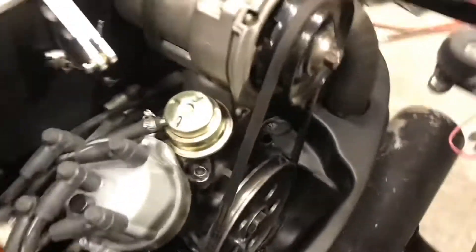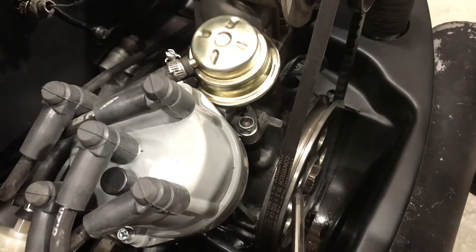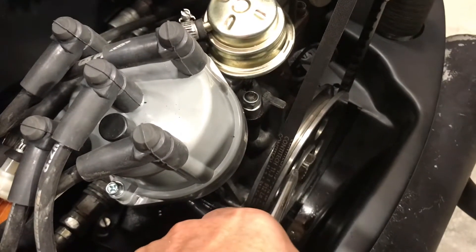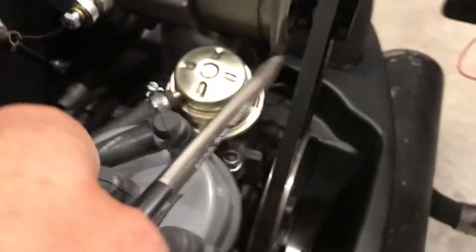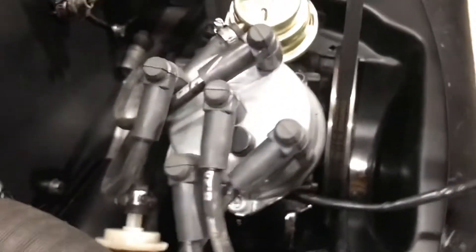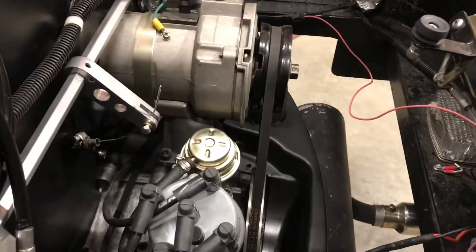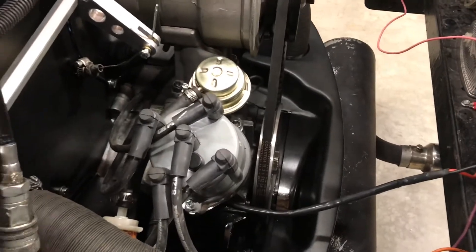For the power pulley issue, this is an aftermarket pulley. When we pulled it off the original engine, Simon had forgotten — or maybe just didn't realize — that there was a shim behind this thing against the shoulder on the crank. So the pulley went in too far, the belt was at an angle, and the pulley was actually coming up against the sheet metal on the engine and locking it up.